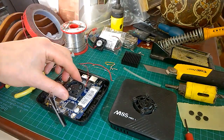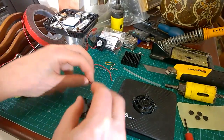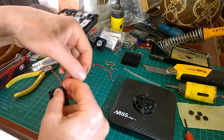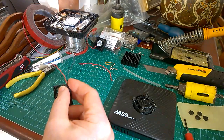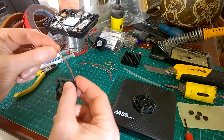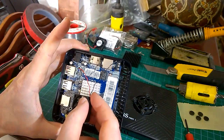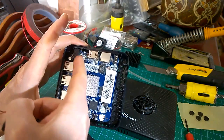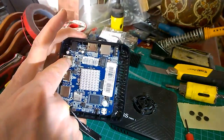In the meantime, what you need to do is solder a resistor into the red lead, I reckon is probably best. I'm going to keep the black lead and attach that to a shroud, probably that one and that one there. That'll give us the earth, and this one gets attached to the underside of the board on the USB, which is going to be there-ish on the other side. It's the pin nearest the power socket. There is plus 5 volts switched USB on that little resistor there.